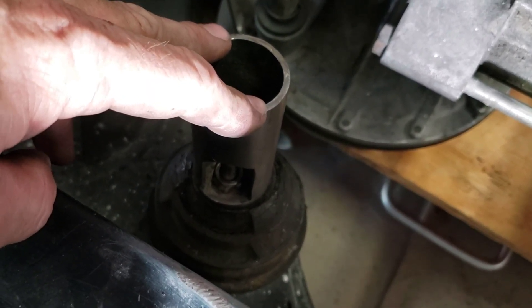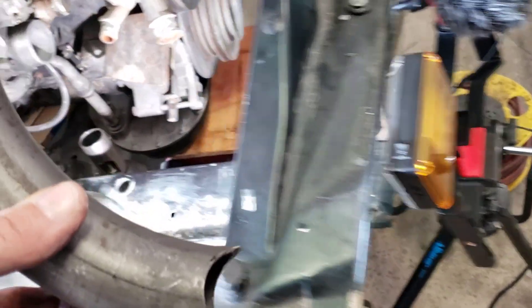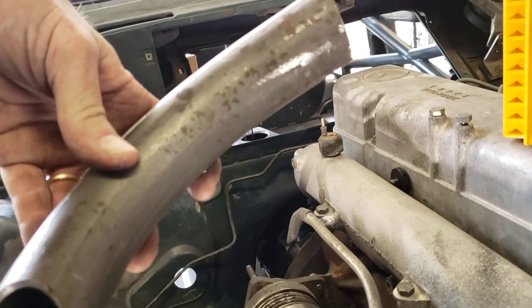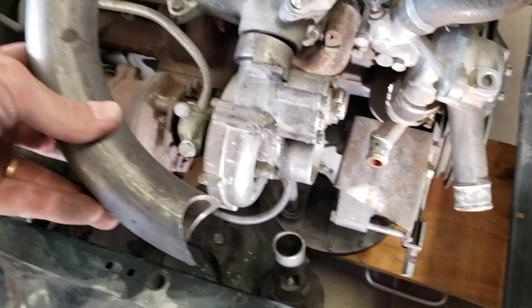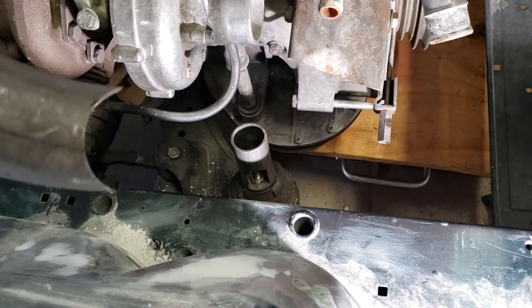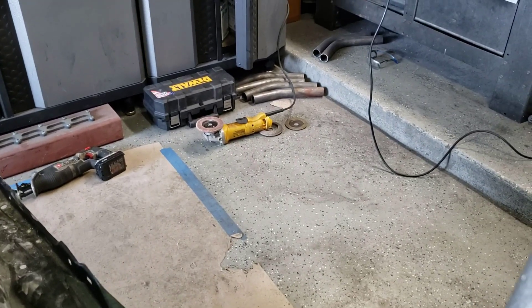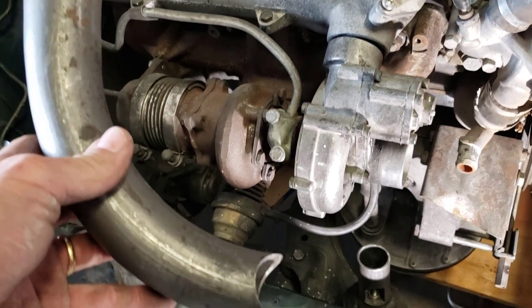It's going to be a much different story when I do the side of this mount. So here it is — this is the engine mount side, and this is where the tube comes in. Looking at the engine, I've got multiple angles: the angle coming off the engine, and the angle of the tube in both directions — it goes up and down and side to side. It looks like a simple bend and it started out as a 90, but it is a major compound angle to work on. The best thing you can do if you're building your own mounts is to get it close — focus on the notch, get the notch angle correct, and then you can start to grind. I've got a flap disc on the grinder. I rough cut the motor mount side and then slowly ground it down until it fit the way I wanted.